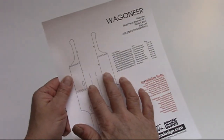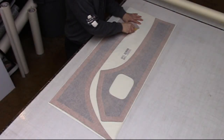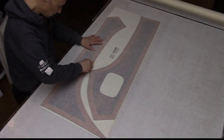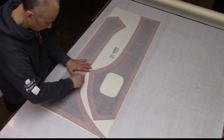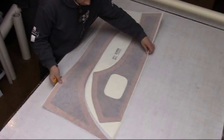Take time to review the product parts list for reference. When you receive your kit, you'll notice that while the pieces are pre-cut, you will still need to trim each piece from the carrier sheet the graphics are printed on. Once the graphics have had sufficient time to settle from the shipping container, carefully trim each piece approximately 1/16 of an inch from the graphic edge.